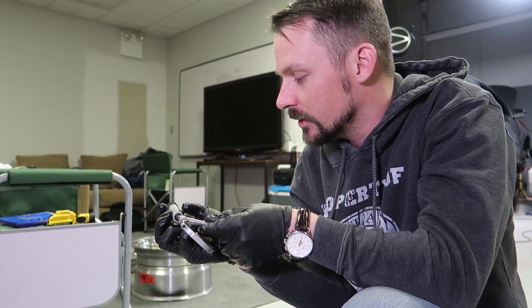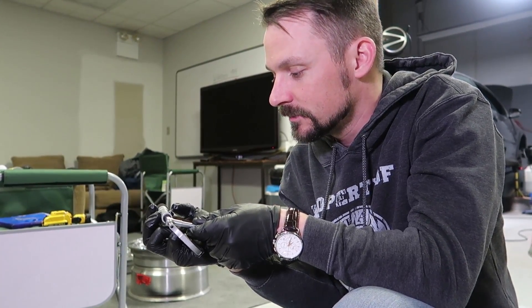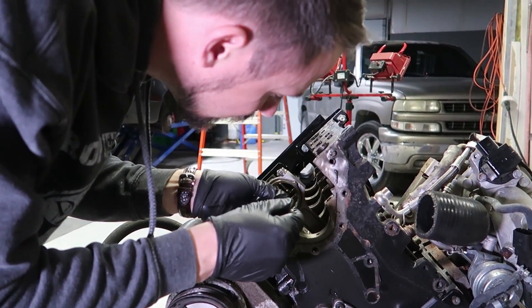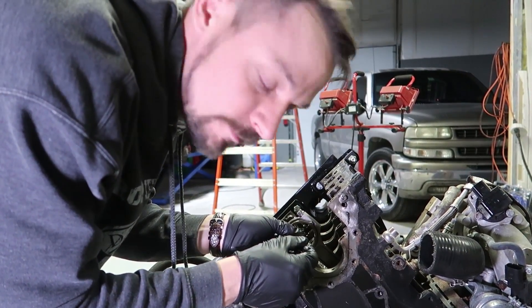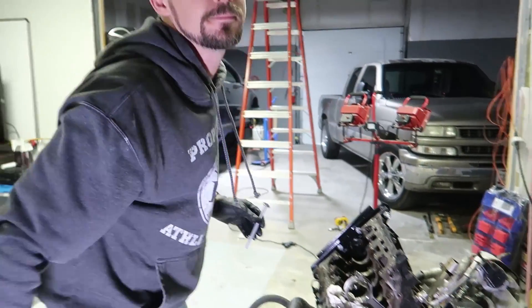One inch 990 — that's going to be four and a half thousandths. Now we go 90 degrees out and do it again. You can already tell — I'm pleased to tell you that the snap gauge is not having to move at all. Oh that's great! Rod is not out of round. Rod is not out of round. Happy days.